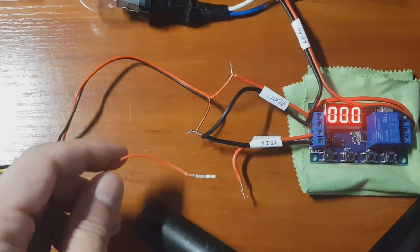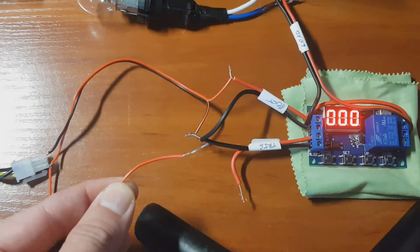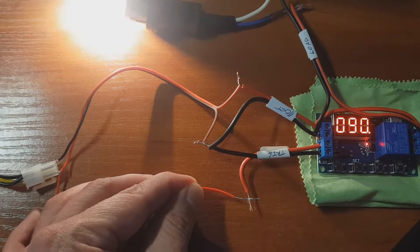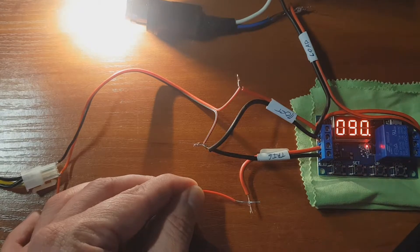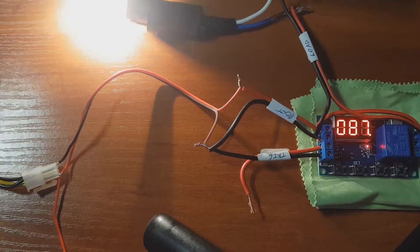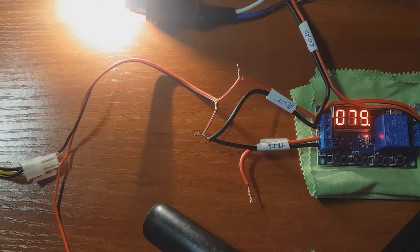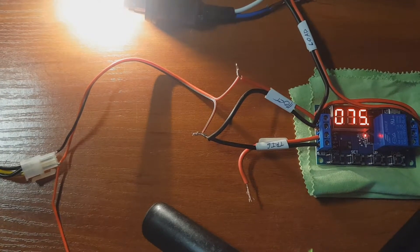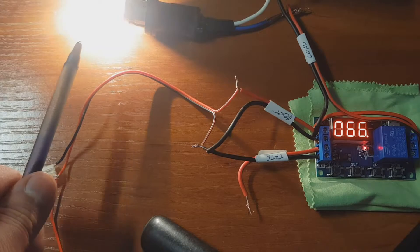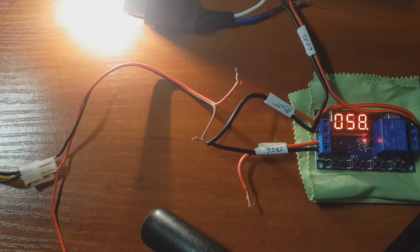So I made this for that purpose — let me show you how it works now. We get this wire from the ignition. When we turn on the ignition, the DVR is gonna start. You see the DVR has started — you see the time, and when we drive the car our DVR is working. When we shut the car off, you see this time going to start countdown. This was 90 seconds. We can set a different time — I'll show you now. So when it counts down to zero, our DVR finalizes all the videos and maybe records a couple more when parked on a parking lot, for safety, and then it just stops.